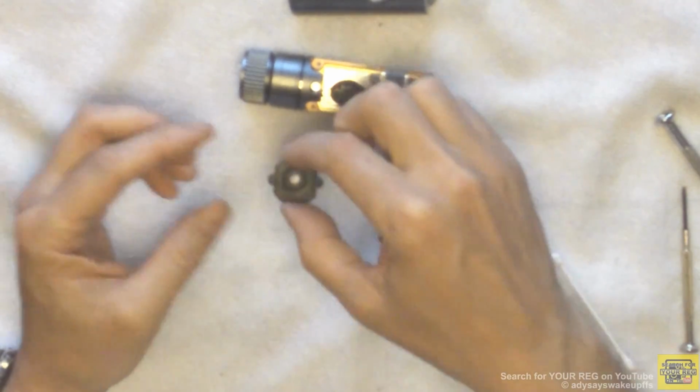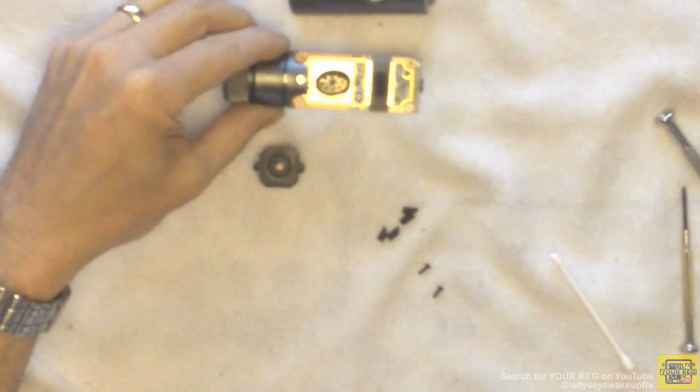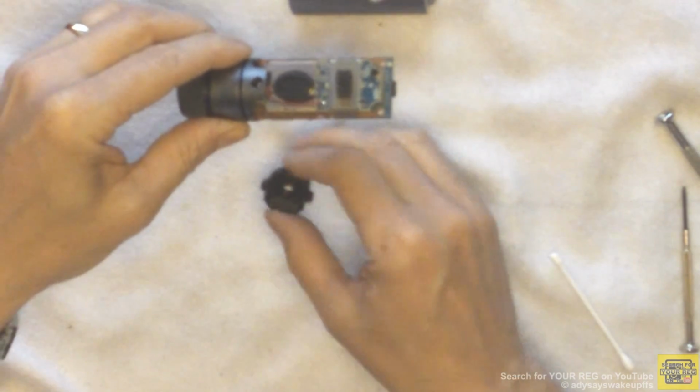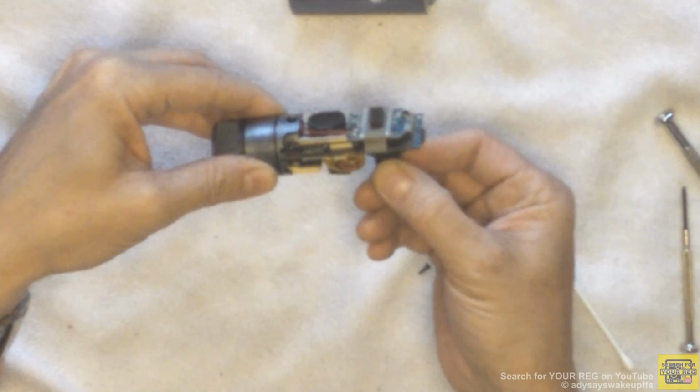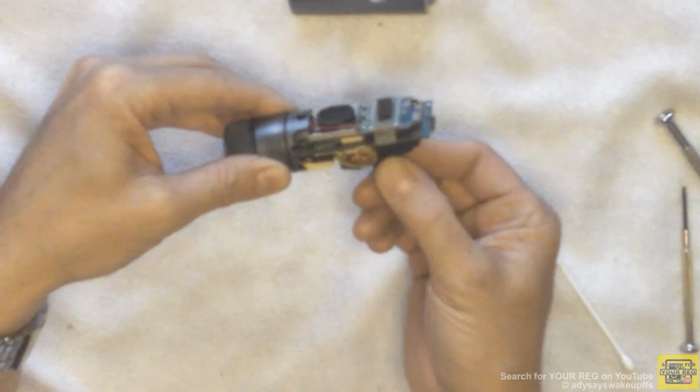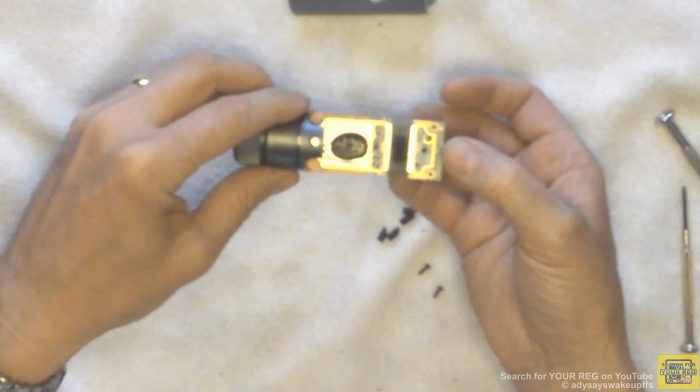With the inside of the lens now clean, all that is left for us to do is to reassemble the camera. To reassemble, first put the camera lens over the sensor back onto the camera. Do this whilst keeping the camera face down so the dust doesn't fall onto the sensor. While holding the camera lens in place, secure it to the main board using the two screws that you removed earlier.